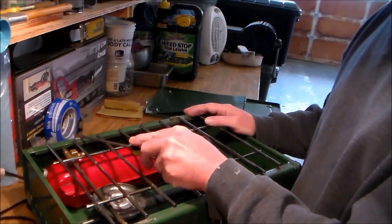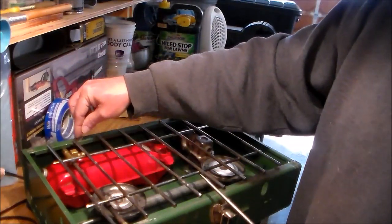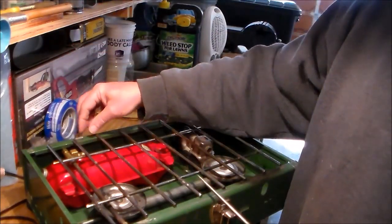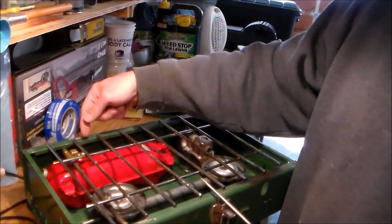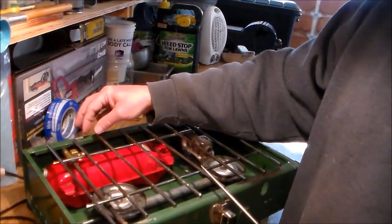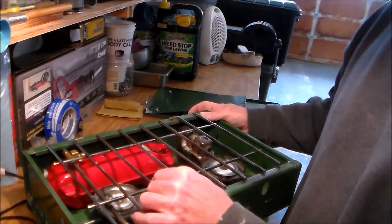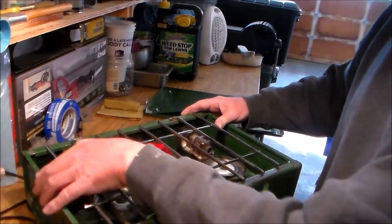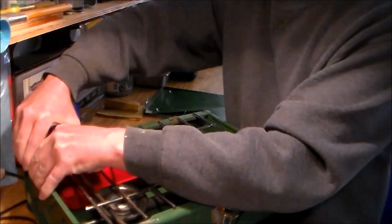Okay, this has the standard old push-through clips. These little clips are one-way clips. They only go in, and they don't ever want to come back out. All it is is a little piece of bent sheet metal, but they have tabs sticking on them. And those tabs, once they're pushed through this sheet metal, spring out, and they prevent that from ever coming out again. So what we'll have to do here is, these things have quite a bit of slop in them from the factory. You just push it in one direction. In this case, I'm going to push it that way, as far as I can. And then we're going to take our thumb and push this bar out through the edge of the clip.